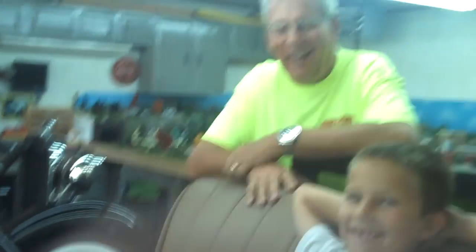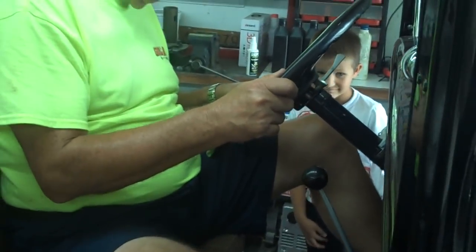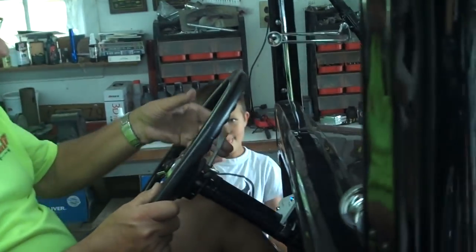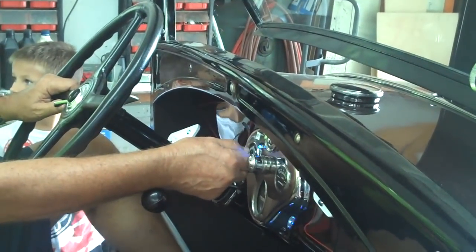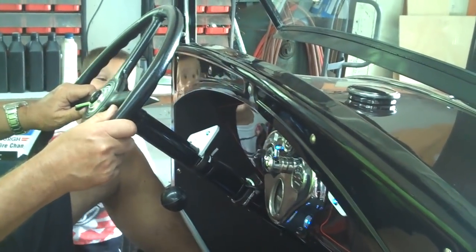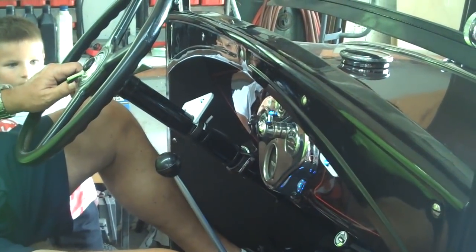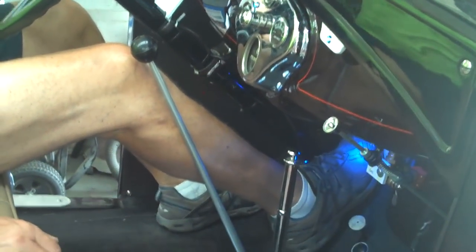It's beautiful. Well, there's one more — he just liked it now. Set the handbrake lever, then release this lever. Next, pull the gas valve on, which is located under the dashboard by the flashing blue light. Release the lever when the light goes solid. Next, raise the lever on the left side of the steering column to the retard position until the flashing light goes solid. Even I did that better than you. Next, pull the choke knob located on the far right side until the flashing light goes solid, then release this knob. Next, step on the starter pedal located directly above the gas pedal — it has a copper ring around it. Release the starter pedal when the motor starts.